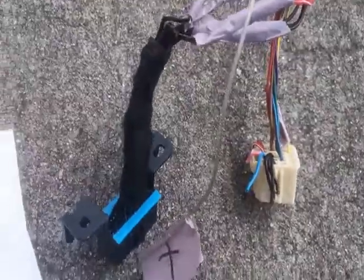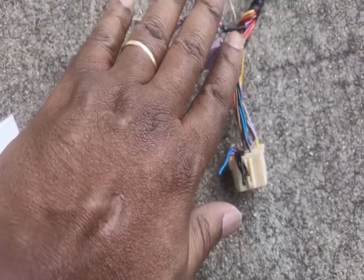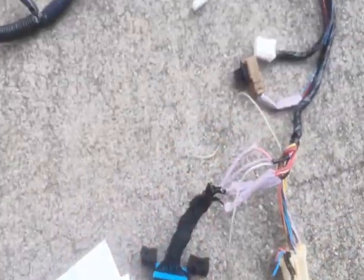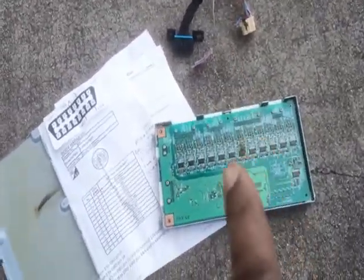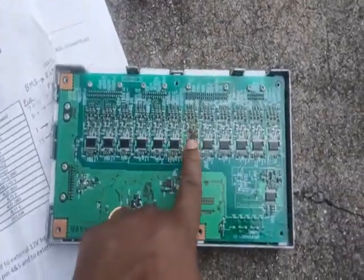To my positive cable I connect this cable and mark it positive. In order for you not to have this problem: when you're using this BMS you cannot be running the car. If you connect your 12 volts from the car you will have problems. Run this BMS independently of the car's 12-volt system, because the entire body of the car is part of the 12-volt circuit and this BMS is going to be connected to your high voltage — 360 to 400 volts. You don't want to do that.